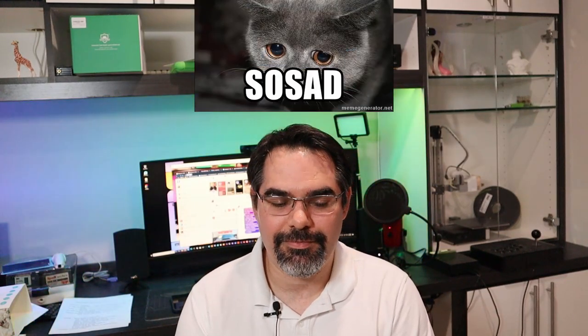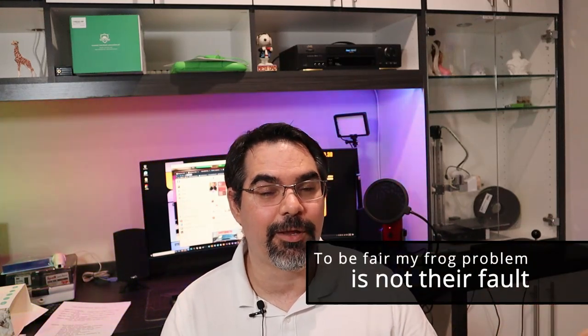If you're a home automation enthusiast and you get this camera and want access to that 12x zoom for license plate recognition or any of the cool things you could do with 12x zoom cameras, none of that works. So I was incredibly disappointed. The ONVIF integration isn't great, I don't have RTSP streams like I expected, it's not 4 megapixels, it's not PoE — which it wasn't advertised as, but it would have been handy. The siren sucks. And a lot of these cameras are using pixel motion detection. I turned it down to medium sensitivity — if a pixel changes, the camera will alert. They add lights to the camera, which draws bugs, and then they have motion sensing. That camera has been recording for the last four hours almost nonstop because of bugs flying around it or frogs croaking outside triggering the sound sensor. It does support a micro SD card — that's awesome.